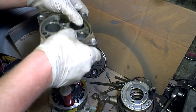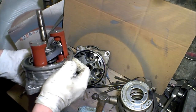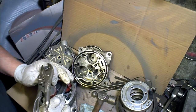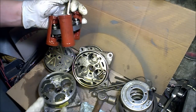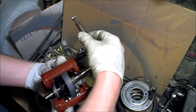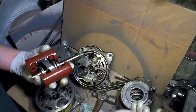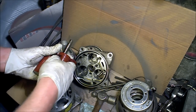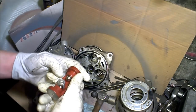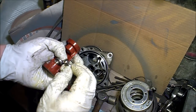Let's snap it in half — there we go. There's our eccentric swashplate, and there at the bottom we have our three pistons that just ride up and down as this rotates. That's the basics. Take one of these little pistons off and you just have a ball with a little cup — that ball just pops out.